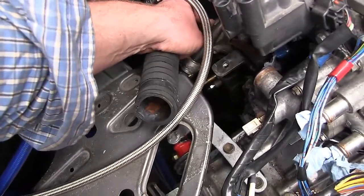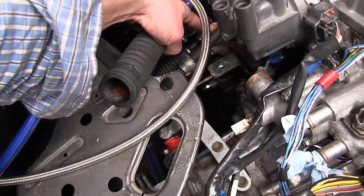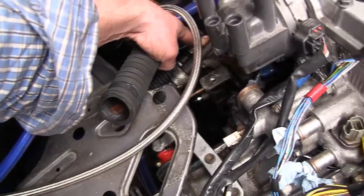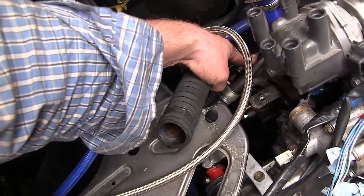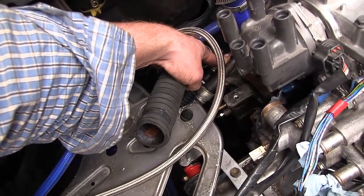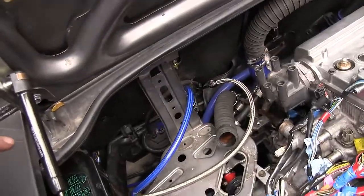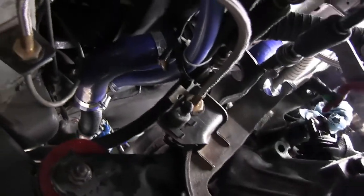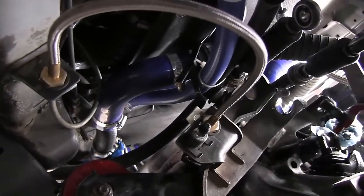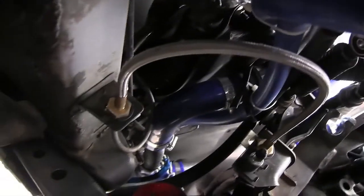The last step here is the clutch line. It's very similar — it has a U-clip holding it to the transmission and then it's screwed on. We're going to undo that. Just be careful: there's going to be clutch fluid coming out, which is essentially brake fluid — very corrosive and harmful. Try to catch that in a container and then plug that line so it doesn't spill everywhere. I have a braided steel clutch line; the U-clip is partially removed — you can see it popping out. We'll remove that line, remove the clip, and have that stainless steel braided line hanging free from the transmission.